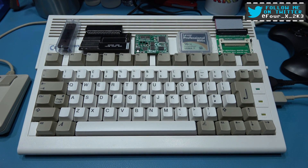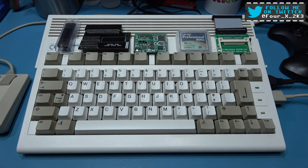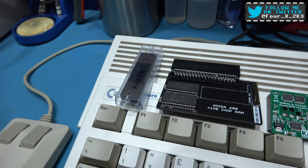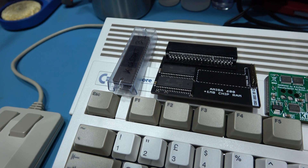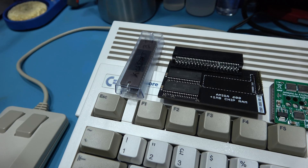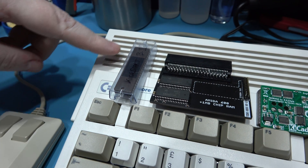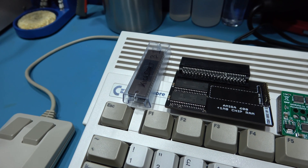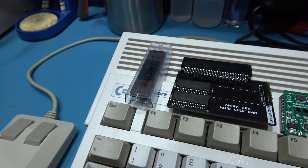What I want to do now is walk you through the upgrades I'm going to be installing in this Amiga 600. I've not gone too crazy with the upgrades — I would call this a standard upgrade. The first thing I'm going to be putting in is Kickstart 3.1. The reason for that is I'm going to be installing a compact flash, and you need Kickstart 3.0 when using Classic Workbench — anything above that is fine, anything below is a little bit sketchy. I already own an Amiga 1200 that has Kickstart 3.1 and I own the license for that.